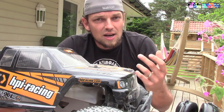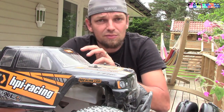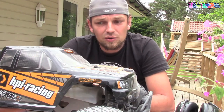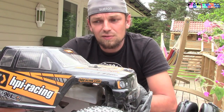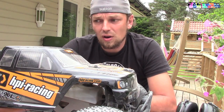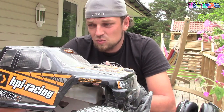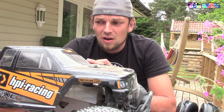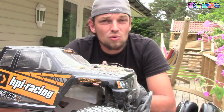I took it out to check if I had a proper spark, which I had, and then as soon as I put it in the vehicle again, you've seen it run when we ran with 3 vehicles all together. As soon as I put it in the vehicle after 1 tank, it fully gave in. So it wasn't that ignition box, it was in fact a spark plug. After break-in, I think HPI will be really wise to supply at least 1 or 2 extra spark plugs, just so right after break-in you can change it out, just like you would with a nitro.